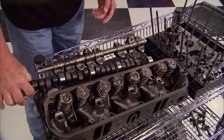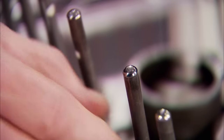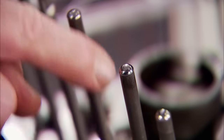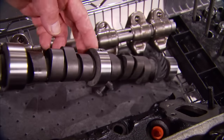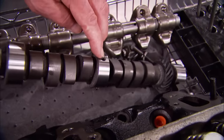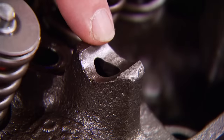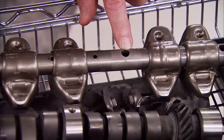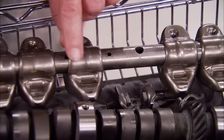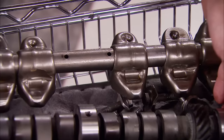Our 360 uses a flat-tappet hydraulic camshaft, which brings us to an interesting quirk in the Mopar's oiling system. The push rods are solid with no oiling hole in the middle, so how does oil get to the top of the valve train? Oil is fed from the number four main to the number four journal in the cam, which has a through-hole. From there it's forced up through an oil gallery, past the rocker shaft bolt via the odd-shaped bolt hole, through a large hole in the rocker shaft, and thanks to smaller holes, the rockers and push rods get fed plenty of oil. A little weird, but it works.